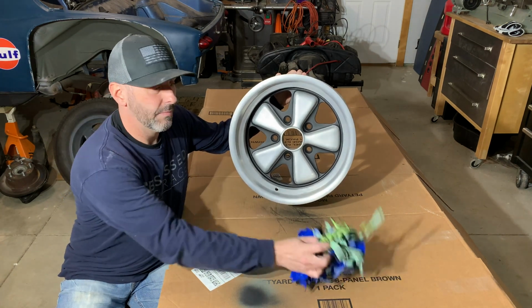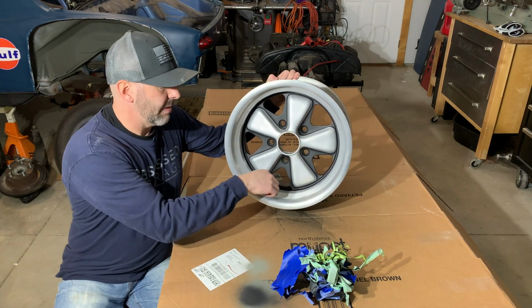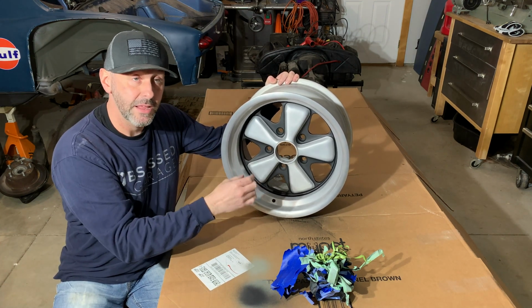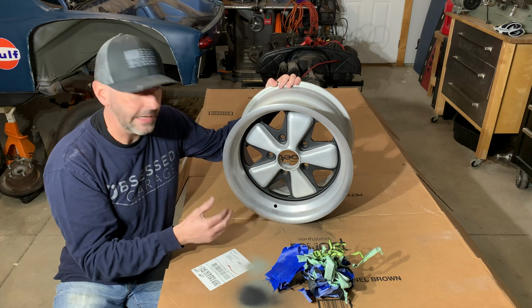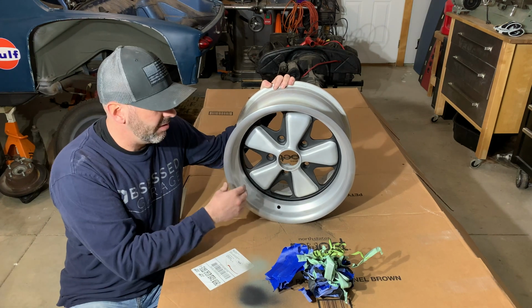One thing to note, when you're peeling all this tape off, peel away from the paint. Like when you're going around this circle, don't peel straight, peel at a 45-degree angle, peel away, make sure your tape never touches your paint, because even though the paint's dry, it's still soft. And the adhesive from this tape, it'll mess up just about any paint. So yeah, we just got it all peeled off.